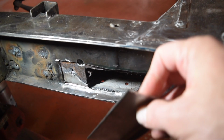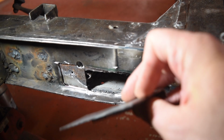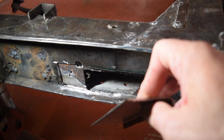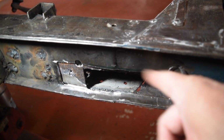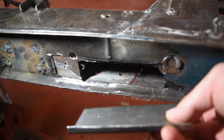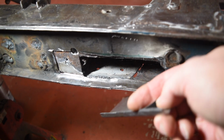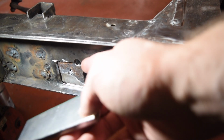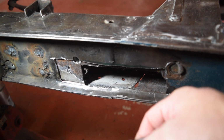So what I'm going to do is try and put, we'll see if my flanging tool will put a joggle. So you can put a joggle along the back edge of that, which will then sit over. Then I should be able to seam weld all along the inside. I can just about see. I think I can just about get the torch in there. So then this lip that's protruding up now will give us something to weld to for repairing the inner structure where this hole is.